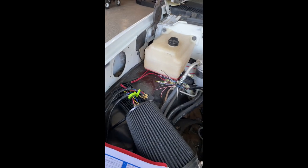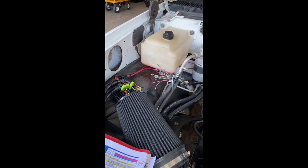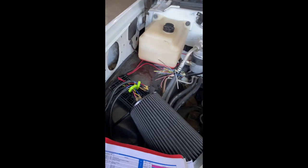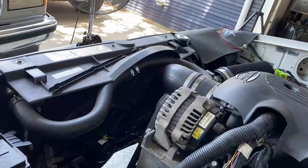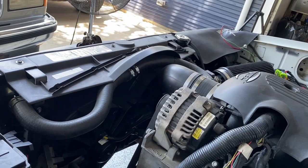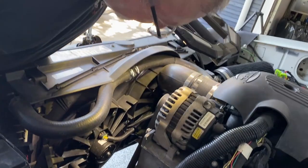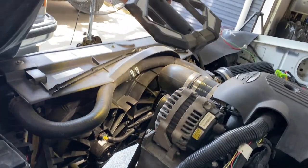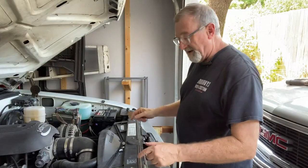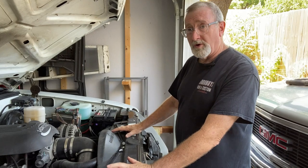Now at the end of the video I will show you a diagram of exactly which prong or circuit of the relay each wire goes to, so you'll know exactly without any mixed terminology. Let's connect the wire to that, start it, and let's see if the fans will come on. Fan number one just came on — both fans are running. The temperatures are set to come on at 185 and 195. And that fixes problem number two — the temperature gauge works and the dual fans work as well.